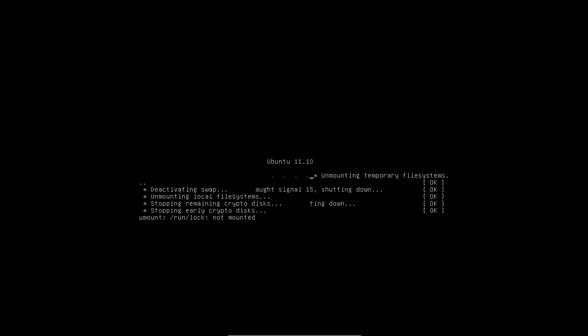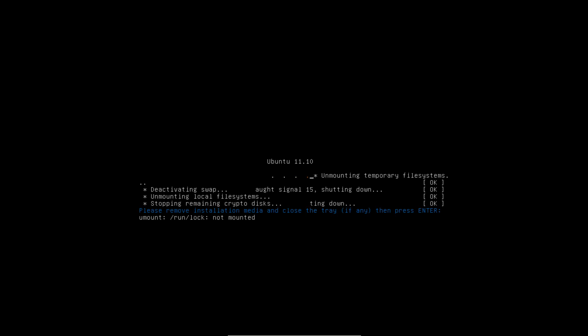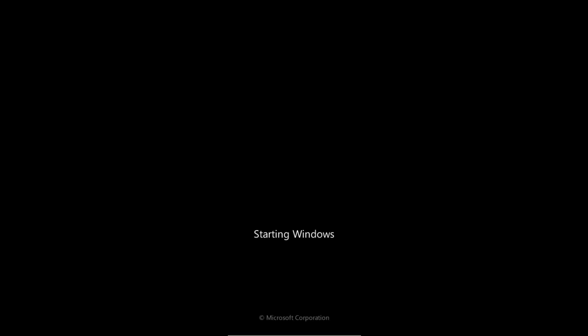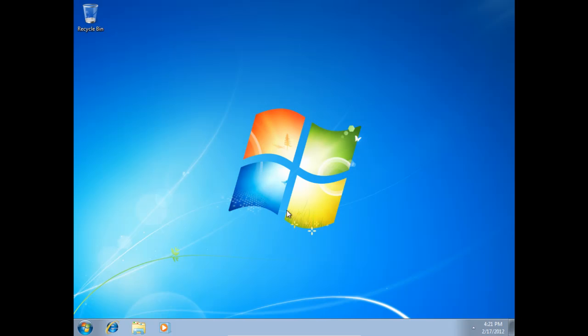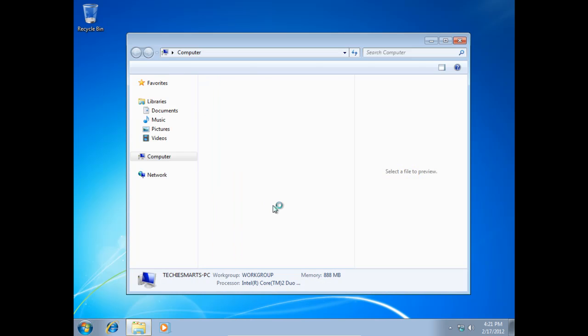There's really no need to unplug your computer and take it to a big box store or some help desk saying you need to save your pictures, because more than likely this is how they'll end up doing it. So I'll go ahead and eject the Ubuntu live CD, press Enter, and reboot the machine to get back into Windows to test that flash drive. Using the Ubuntu 11.10 live CD, it's a little more straightforward — you don't have to right-click and choose root access. Even though it's not really a whole lot of trouble to do that, it's a good practice to use multiple versions of live CDs. If nothing else, you know how to use more than just one version. I typically use Knoppix for older computers and Ubuntu for the newer ones.